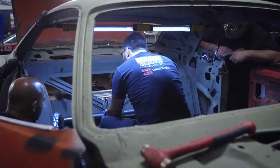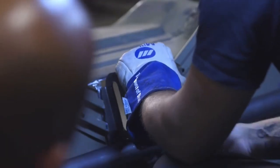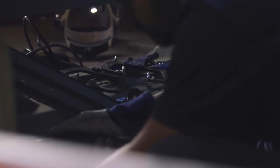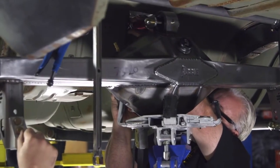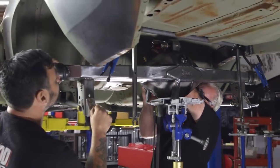Some of the disadvantages are, although the 3-Link suspension is really common in race cars, you don't often see it much on the street, and the reason for that is packaging. That upper center 3-Link usually has nowhere to go in a street car. You're going to have to cut into the floor and make that mount, and there's going to be fabrication skills needed and a bunch of work. Space is going to be taken out of that interior and you'll usually have to make some kind of compromise for a street car.